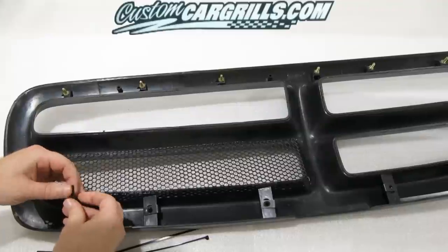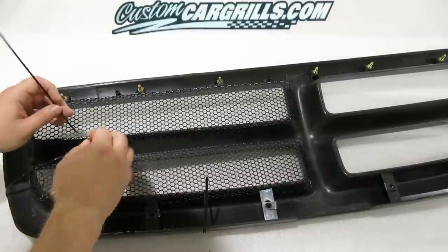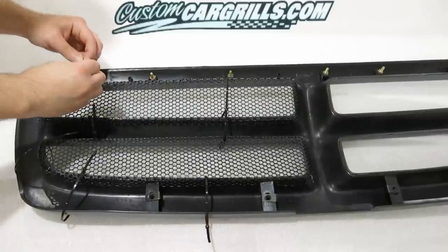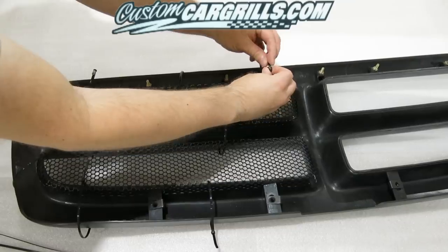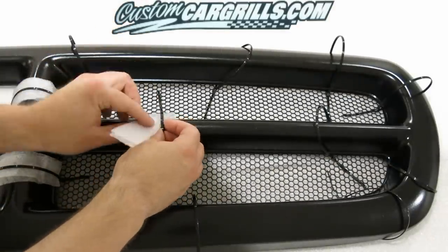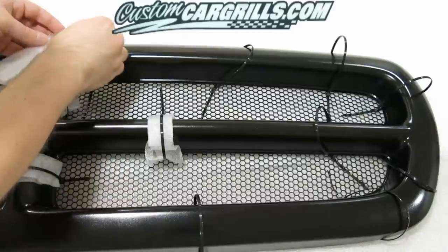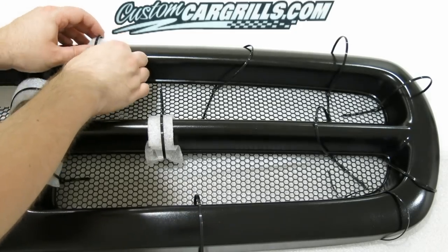Now it's time to affix the grill mesh to the grill shell itself. In this installation, I'm going to be using an adhesive. The first part of it is simply to loosely tie down the mesh to the grill shell. In order to do this, I'm just going to use some simple cable ties and run them around the grill shell and through the mesh. This will give a loose hold just to kind of keep them in place for now. You can use other methods of securing the grill mesh — some people like using clamps or weights — but I like using the ties because it gives me a lot more precision. Now I'm going to flip it back over to the front and in order to protect part of the paint job, I'm going to insert some little pieces of foam in between the ties and the bumper before we fully tighten the ties down. If you miss this step, sometimes you can damage the finish on the grill shell itself. A lot of people will over tighten the ties and it will start to dig into either the plastic or the paint itself.